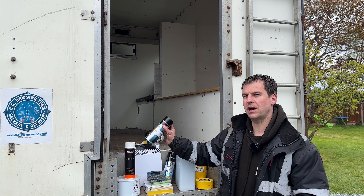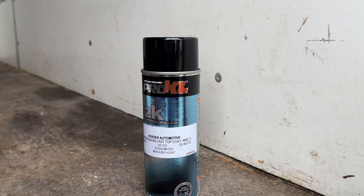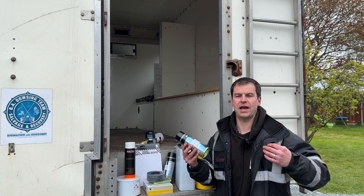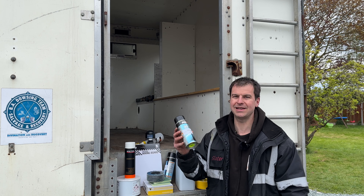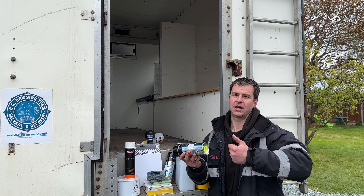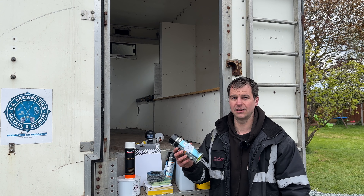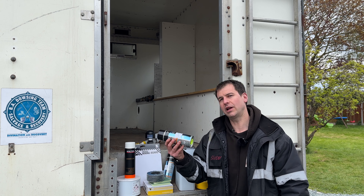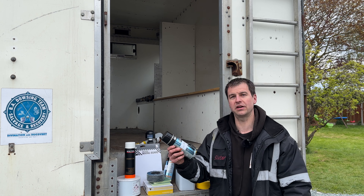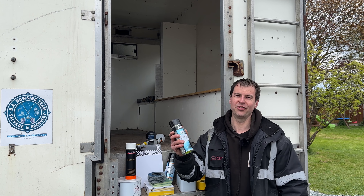Another couple of coats of epoxy primer and sand it back with 500 again to give it that nice finish. Then — and this is the bit I'm excited about — these cans are so cool. Normally with a spray can you've got to use an acrylic, however this is a really cool design. This is a 2K or 2-pack paint in a can, and what you do is pull the pin on the bottom, give it a twist and that releases the hardener into the can. So that means the single can will work like a 2K paint. I'm really excited to give this a go for the first time — let's get cracking on the cab.